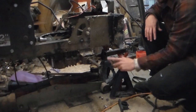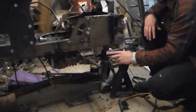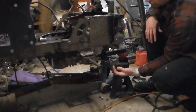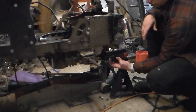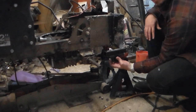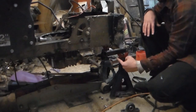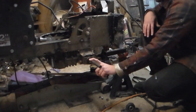What I've done to start with is I've cut out these pieces here and I've drilled holes all the way through so that my pillow blocks can mount up. We're actually going to gain about an inch and a half or so of lift because the live axle is actually going to be running down in this area, which is about an inch and a half lower than the original axle was.